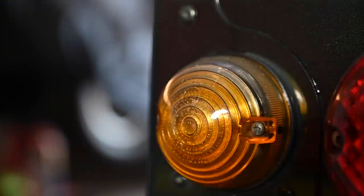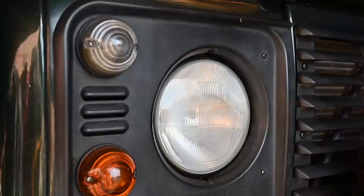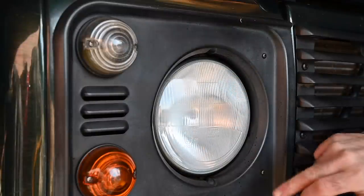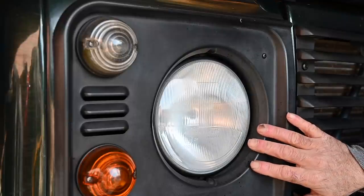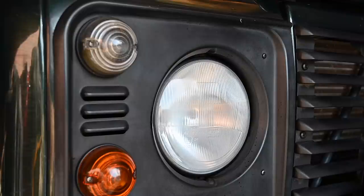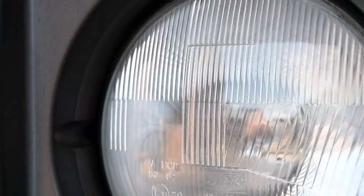You can also notice on the blinkers that the top part is already faded away — there's still a little bit of yellow in the middle. The headlights are not much better either; there's kind of a haze on them. If it's inside the lens itself, buying products to polish it isn't going to help you very much, and you pay way too much for those products anyway — and they don't last. So you're better off changing the lights.